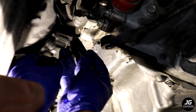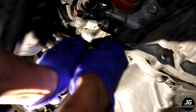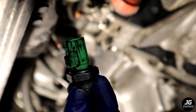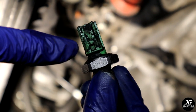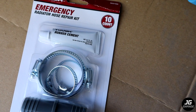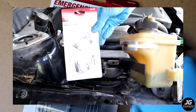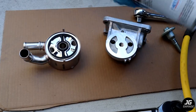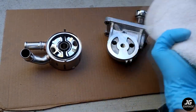Now I'm going to unplug the oil pressure sensor from the connector using a flathead to push down the locking tab, and clean it thoroughly. I'm going to be replacing the old clamps with screw clamps from Walmart since I find them easier to work with. I actually recommend buying a wider-clamp kit from Walmart instead. Before installing the parts together I'm going to clean the new oil filter conversion housing with brake parts cleaner to make sure it's nice and clean.